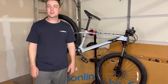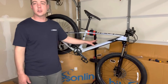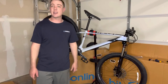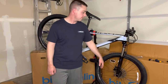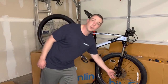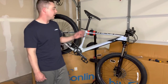Thanks for watching this video — this was a simple how-to build for pretty much any type of bike you get from Polygon or Bikes Online where you have to assemble it yourself. If you want to see a full suspension build, check out my Siskiu T7 Polygon bike build where I go through how to set the sag and check rebound. This bike has a hydraulic fork so you're not worried about air pressure — it's pretty much set up from the factory. It does have a rebound adjustment at the bottom of the fork.